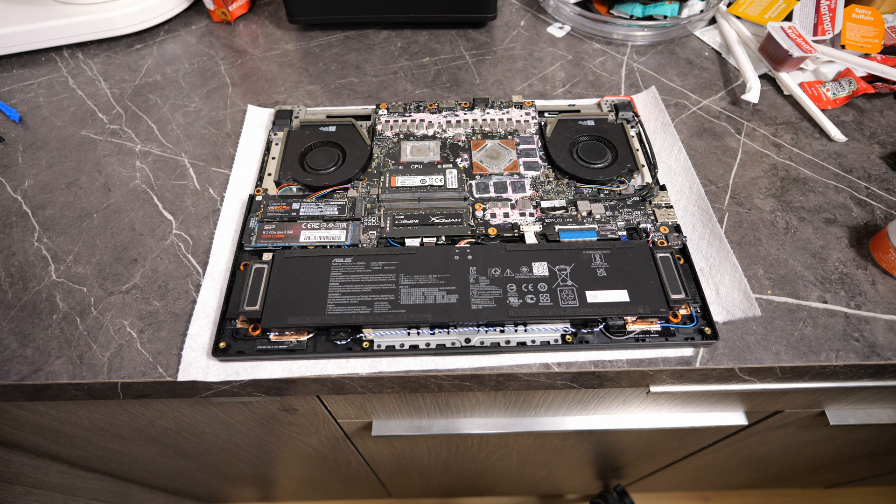I'm going to try putting on as little as possible, just a little bit, and hopefully we won't have any issues. Then I'm going to put the cryo sheets on last so I'm not blowing them all over — they're so light and so easy to move around, and also very fragile. If you try to cut them, sometimes they'll just snap in half. The CPU one was pretty close, but the GPU one I think I had it spilling off to the sides, which is probably not good for contact. I'll try to cut that one.